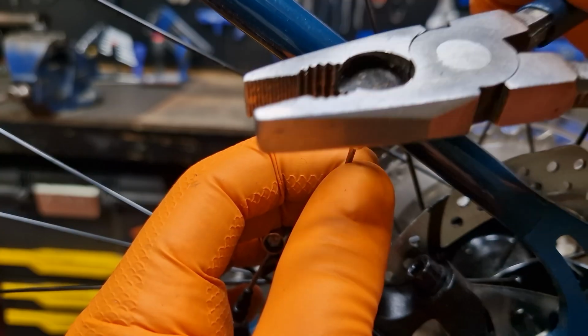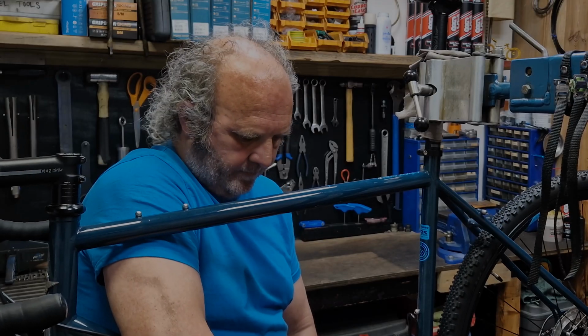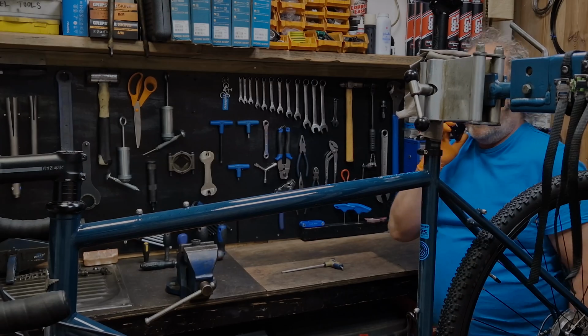The final thing I do is cut the inner cables down to length and crimp the end caps on. I never ever crimp the cables before the final bolt check is done. If I get interrupted and there are no cable ends, I will start the final bolt check again. The consequences of not doing the whole final bolt check range from ongoing continued nuisances to the lights going out permanently.